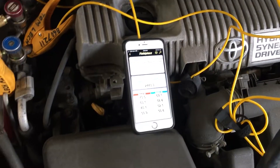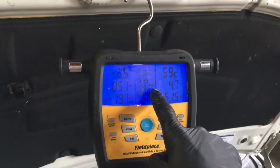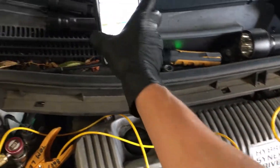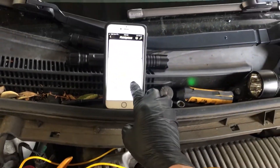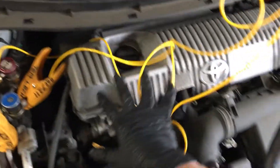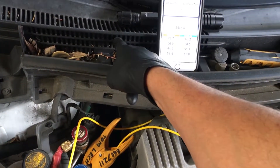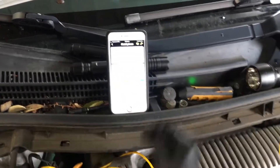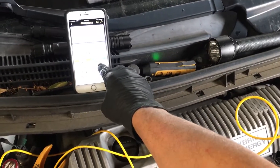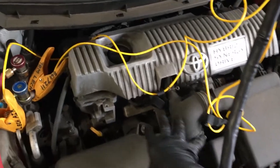We've got 69 degrees coming out of the dash, but our ambient air temperature is 55 degrees outside. We're getting 69 degrees out of the dash because the hot air off the fan is getting sucked in right here, and there's no cooling being provided by the evaporator under the dash. So blowing in your face out of the back it's 70 degrees because of this air temperature right here.